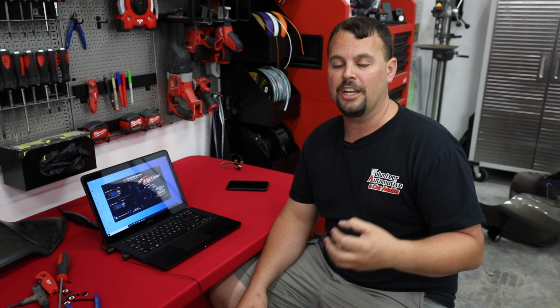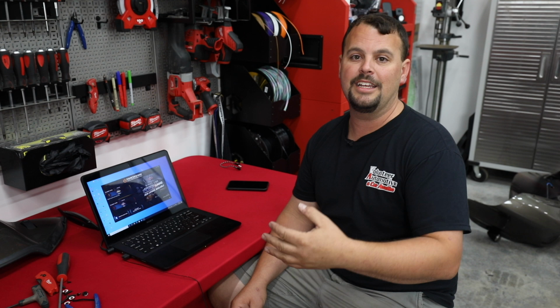So it's going to attenuate that level of the radio down to make almost all the amplifiers, especially all the ones we use, happy with the amount of input voltage. So we're not overdriving the input, which gives us really clean output. But we're still giving it way more signal than RCA cables, so we're not having to gain the amp up nearly as much, which is where we lose a lot of that noise.